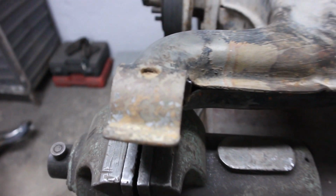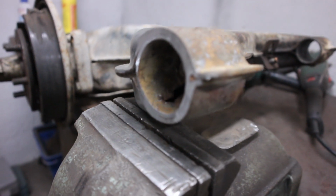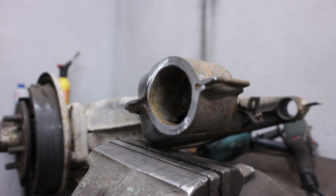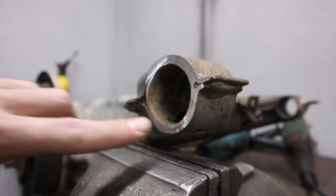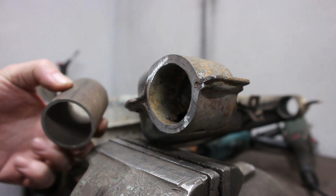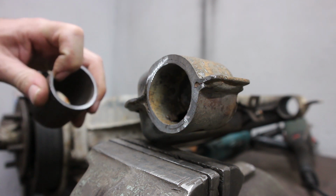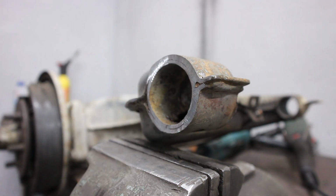So this is another swing arm. I've already cut the tube at the welds and ground them a little bit. I'm not sure if you can see it, but let me set you down over there, and there you can see the pipe. I just want to go in with the hacksaw, split the inner tube so I can weld the new one which I got. That's 48 millimeters OD and 42.5 ID, so that should be a perfect fit in there.